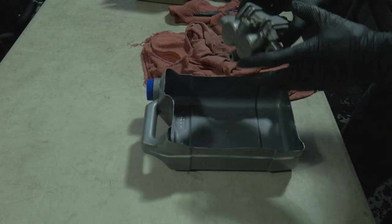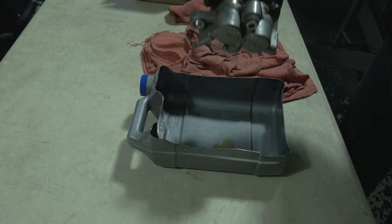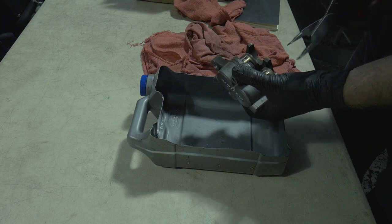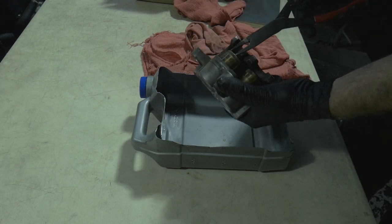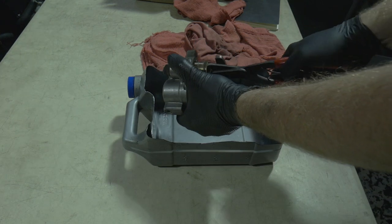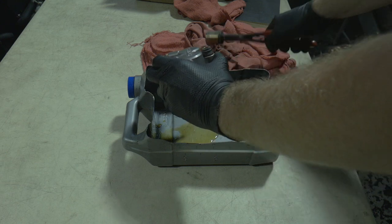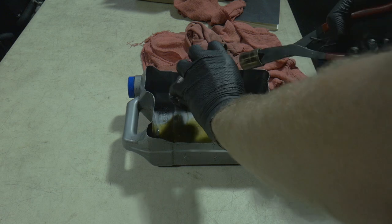We've got to get this brake fluid out — grab something simple to drain most of it, but the majority is going to come out when you pull the pistons. These right here are some reverse pliers — I think these work amazing, I'll put a link in the description below. I'm just going to grab the inside of this piston; I now have full control of it and I can spin it and pull it right out. Grab this piston and do the same exact thing — pull them both out.